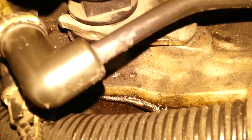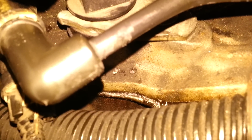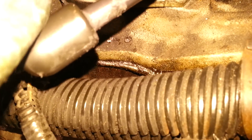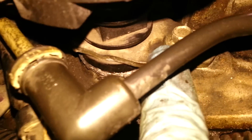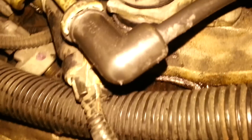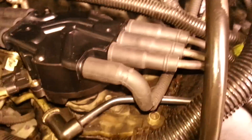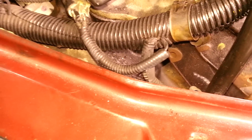What you have to do is go back out and turn the crank clockwise — only turn it clockwise, never forget that. I had to turn the crank just a little bit for the distributor to fall in. I put the screw in partway just to hold it, turned the crank, and the distributor dropped in perfectly. To double-check, I set the crank back to TDC — top dead center — again.